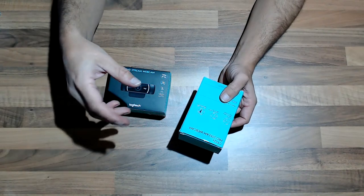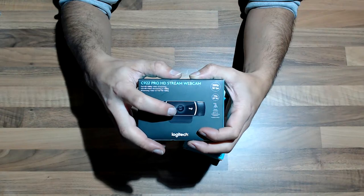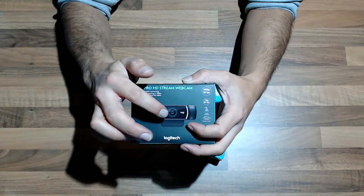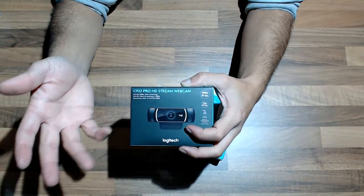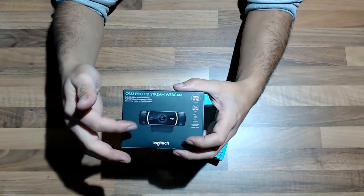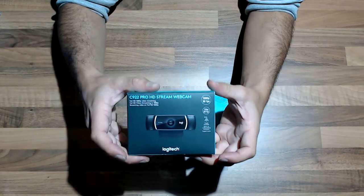The problem is that when the camera tries to autofocus, the lens inside moves up and down, and you are able to hear the sounds from the mechanics inside. This is not some kind of motor — it works more like a magnet, so the lens moves up and down. When it's focusing you can hear the camera inside working. In my opinion that's just bad, because you paid about 90 euros for this camera. It has two microphones, and inside it's all just empty — they should have protected this better, because the microphones are able to record the sounds when the camera is moving.